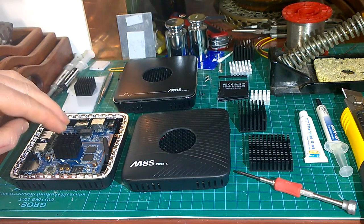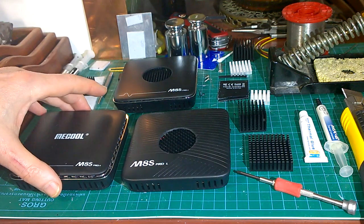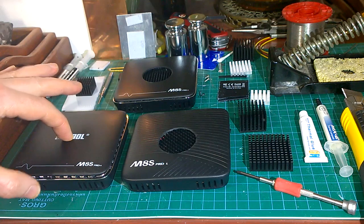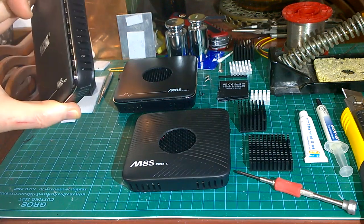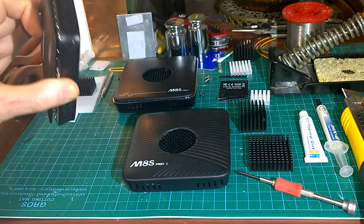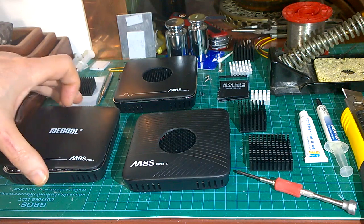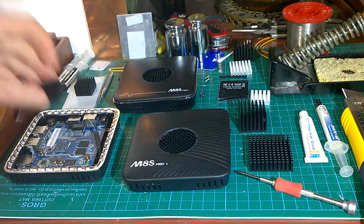You really need a bigger heatsink. I quite like this one, which is 22 by 15mm - it fits in like that. This one is really good because it just lifts the lid ever so slightly and works very nicely. When it's horizontal it still has a problem getting the heat out, so you have to turn it up on its edge so that air can go in the bottom and out the top. With the lid lifted slightly it doesn't matter as much - you can put it anywhere with sticky-back velcro.